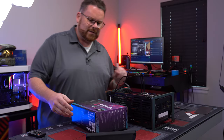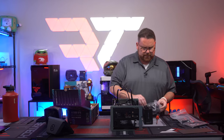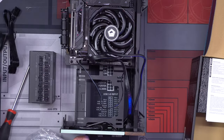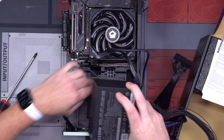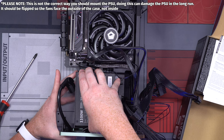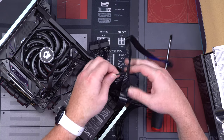There's not a whole lot to this build when you think about it. Here is our PSU — look how tiny it is. That's 1100 watts right there, that's all you need. We only need two cables: one CPU cable and the big motherboard cable. There is a 16-pin connector, but we damaged it, so we're using the extension. Run it this way for airflow — you want it to blow into the PSU for better GPU thermals, which actually gives better temperatures.